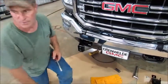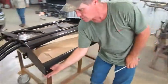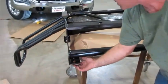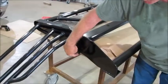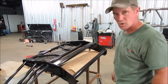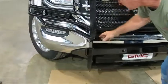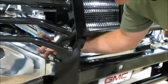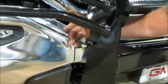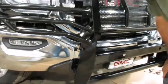We're going to come around to this side where the guard is. He's going to walk around and follow me to the bottom brackets — we just got the bolts right here, we call them the shoes. You can see two holes right there. Your top bracket — you can see there's a tab right here. That top bracket is going to go to that tab. So we're going to get this guard up there and show you how to align everything up and get it all tightened down. We've got the guard on the truck now. We showed you where the bolts go for the shoes. We went ahead and tightened everything up. The top bracket we showed you — where that bolt was — goes underneath the tab on the guard. Just make sure you put the bracket under the tab on the guard, or you can set the tab down onto the bracket and it will help you line that up.